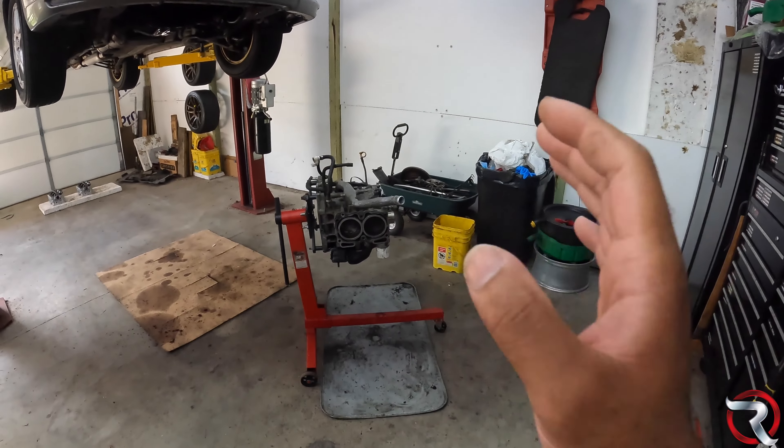It's kind of funny — everybody who comes to me with a leaking issue, most of the time it's actually power steering fluid dripping down the back of the engine, because that's where the power steering lines are. It's rarely actual oil unless it's coming from the sides of the valve covers. I can't really do much about the power steering lines — it's out of my wheelhouse — so I'll just clean everything up and call it a day. Let's get rocking.